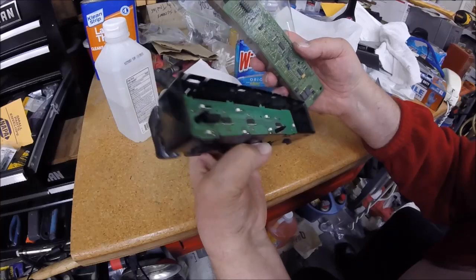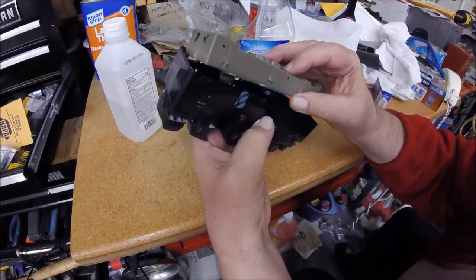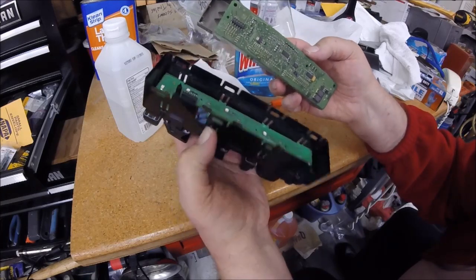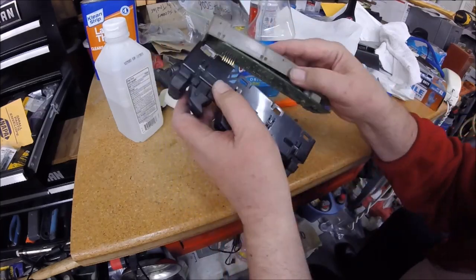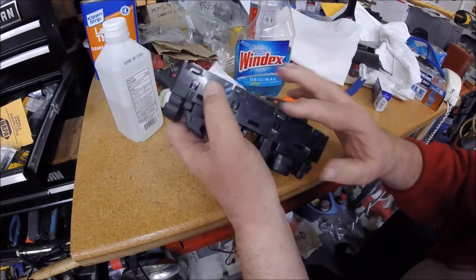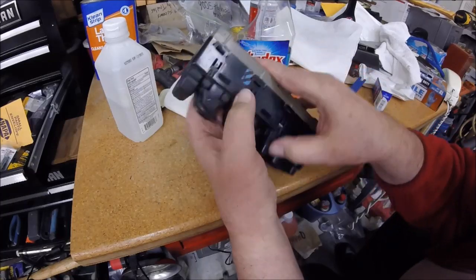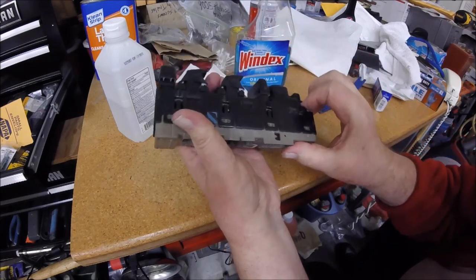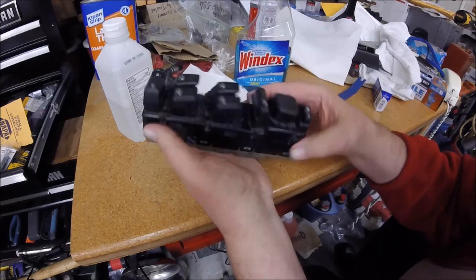I did blow that off with the compressed air cleaner but it really didn't do much. I'm going to make sure all those pins get lined up - just one end, and it sits on a post here. They have a little tapered end where this thing sits on it and snaps in. It's kind of overkill with eight tabs, but they're there. We're going to gently slide that together, get the other side in, and voila - we're back together. We're ready to put this thing back in the car.